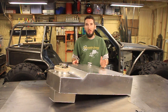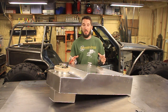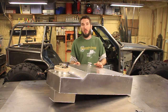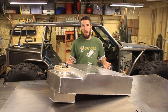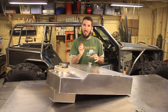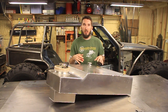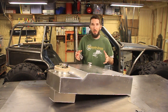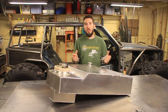Let's talk about the safety mechanisms of a fuel cell. Normally they are made to take an impact and keep you safer in the event of a crash. What you don't want is your fuel cell or gas tank to split open and all that fuel go flying around inside your vehicle — that would be really bad. So normally, like on a race car, what they have is a bladder — a rubber bladder. Inside that is foam. The foam, even though it's completely taking up the entire bladder, has these little tiny air pockets, so it only takes up about 2 to 3 percent of the entire volume, and the gas still flows inside of that foam. The foam does several things: it keeps it from sloshing around when you're going around turns, and it keeps it from exploding and going all over whenever you're in an accident or a wreck. So that's the bladder style and the foam.